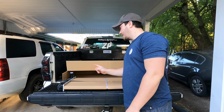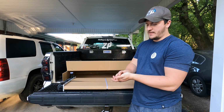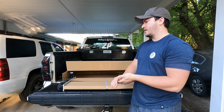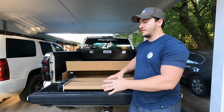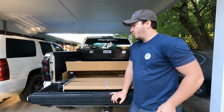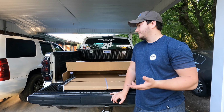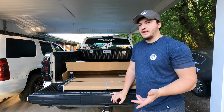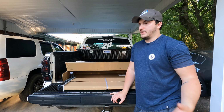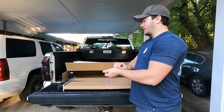The only thing that's kind of a bummer is I'm gonna have to keep the 28-inch shroud for right now. I think it'll be okay, just because it'll still get plenty of cooling through there. And as the truck's moving, obviously it'll have all the rest of the surface area to cool it down, keep everything like it needs to be. I would spring for the 34-inch shroud, but here soon I'm going to be getting the E-fans in, so it doesn't make sense to waste the money on the shroud when I'm getting the fans in soon.